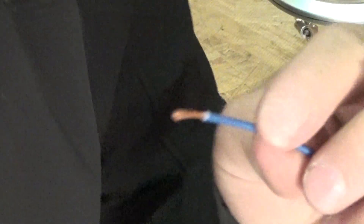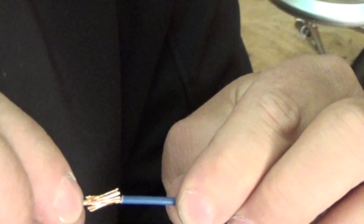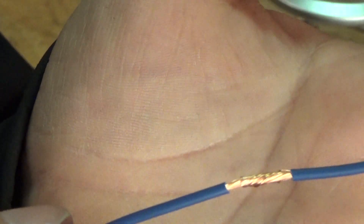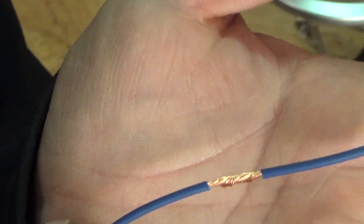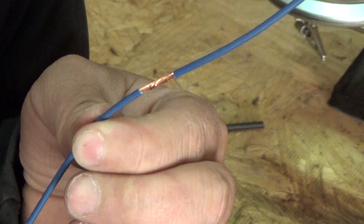The way I'm going to say to do this is to take the wires and just kind of push them together. You can see how they're just kind of flaring out as you push them in, and then twist the joint so that you wind up with wiring that looks like that. And that is what we're going to place into our helping hands and solder.